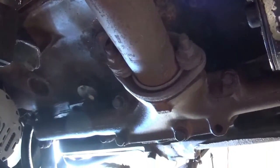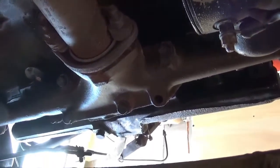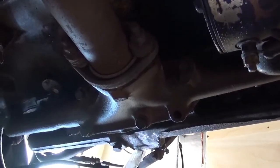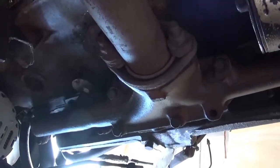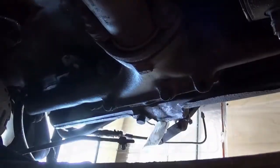So, I'm going to loosen the rest of those off by hand, get that manifold out of there, go to the easy stuff. One note, when it comes to these, I like doing the exhaust manifolds first because sometimes they suck, they take a lot of time, they can be very frustrating, so I put them behind me.